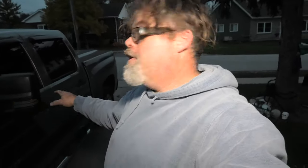But like I said, when you buy these mirrors for your truck on eBay, they're pretty good. So I'll put the link below for that. And remember, when you hook them up, signal lights work. In most Chevy Silverados, it's already pre-wired. Heat works, which is pre-wired, and the power works. But you have to hook up your marker lights and your backup auxiliary lights. These are called auxiliary lights, so you can use them for whatever you want. I'm going to use them just as the dome light, hey?